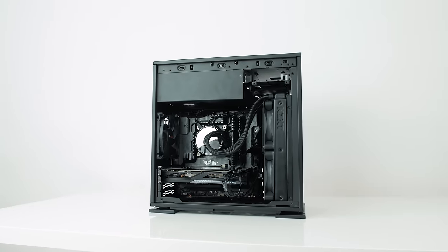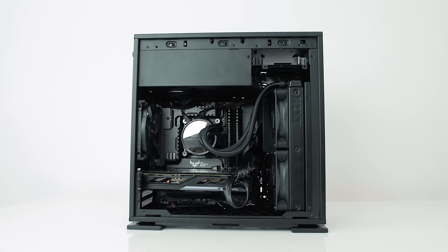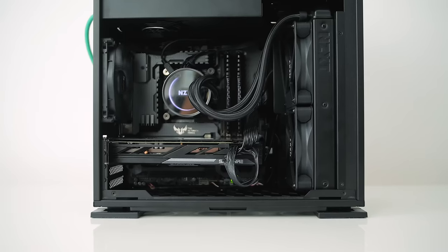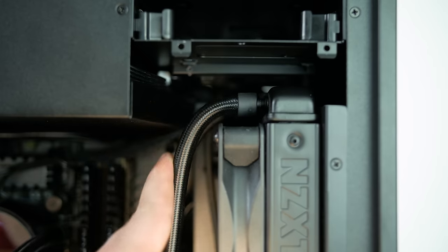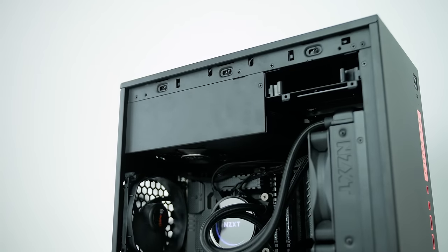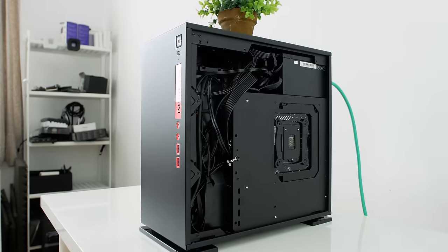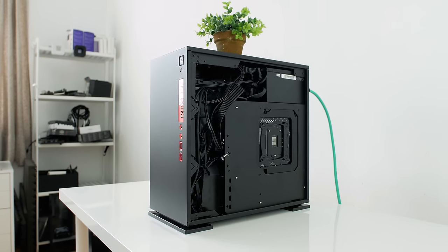Taking all that into account, here's the full build. It's a little bit messy, because the main opening is not that large, and many of these cables have to cross the motherboard to their final destination — particularly for the USB and the IO cables. Keep that in mind if you're installing fans at the bottom too. I installed the radiator and then the fans, as the tubing at the top would otherwise interfere with that area, so your radiator fans have to be configured in a pull setup. It would have been very good to see the power supply shroud be a little bit more open for cable routing, or at least larger cable cutouts, as this was not an easy space to work in. Coming around to the back, it's actually quite simple to clump your cables in this area and use some of the small cutouts on the motherboard tray for cable tie points.